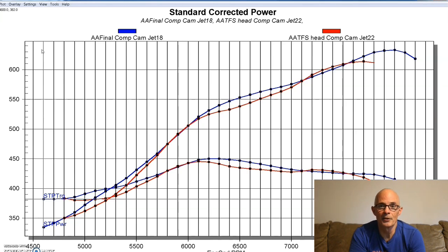I thought it was going to be interesting because we had enough bore size to fit those heads on even though we had the short stroke. The LS3 heads definitely flow a ton, so we had more than enough airflow to support the power level. But you guys can complain about the change in compression ratio and that these heads didn't get a fair shake - this is just something we did while we had the thing on the dyno. Here are the results of the comparison between the rec port and cathedral port heads. Should we give it another shot? Do you think these guys got a fair shake? Let me know in the comments.